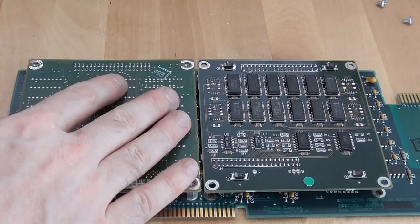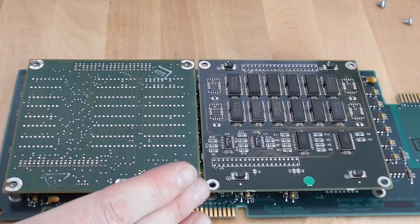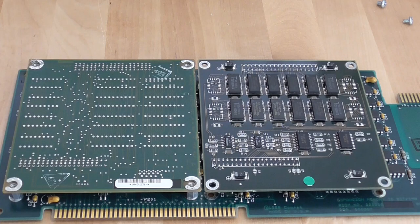It's not too surprising to find that the 1MB board actually fits on here just fine. When I look at the settings, it says the 1MB board should be on the A side and the 4MB on the B. They've put that information on the sticker on the side of the machine rather than labeling the board itself, which is not ideal. This is the A side and this is the B side. Powering on — there should be 1MB on the main board, 1MB on the expansion board, 4MB on the first module, and 1MB on the second module — so it should count to 7, and it does. We've upgraded the RAM. We're getting beeps saying memory size error, but that's probably because I need to run the setup program.